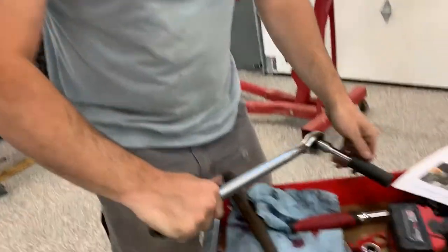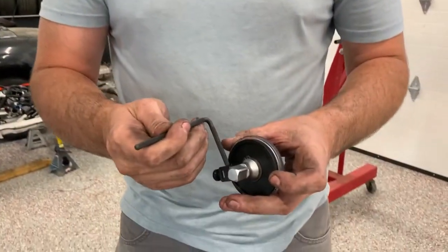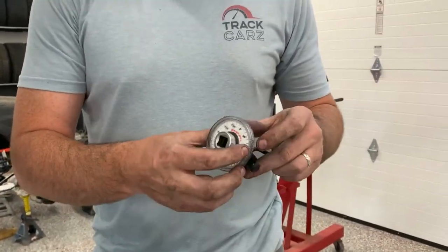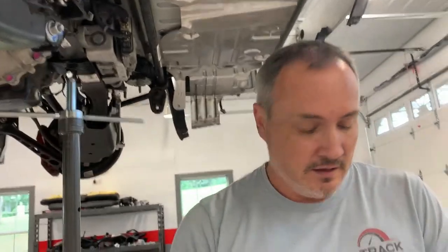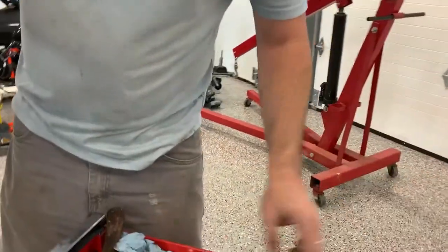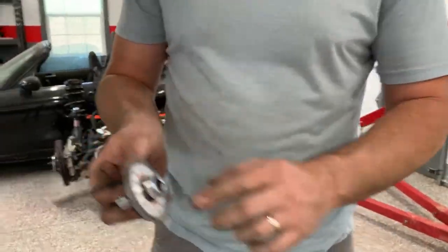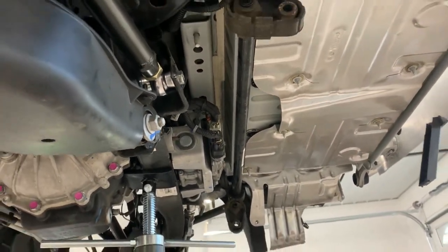So it says once you torque it, you need then to go to an angle. It's another way of torquing. GM is very fond of this method. There's a couple things you can do. One is if you have a little angle torque gauge like this, you can use it. Basically set it in line with what you're torquing, with the sockets or whatever, and use a regular ratchet and you go to the additional degrees. I can use it. Since most people don't have one of these, I'll show you another option.